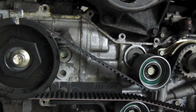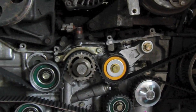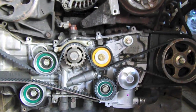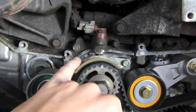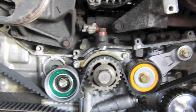The camshaft sprockets are on and the timing belt went on great. Pull the pin on the tensioner and rotate the assembly at least two times — you can see we're all lined up and ready to rock. We just put the covers back on and get this engine ready to go into the engine bay. Before we get the covers on, there's one more thing to explain: this is called a bump guard. It's a little guard that sits on the crank sprocket, sitting very closely to the belt without touching it.